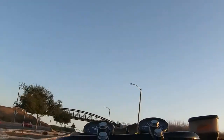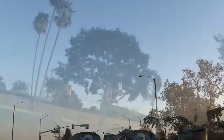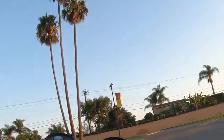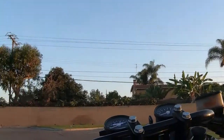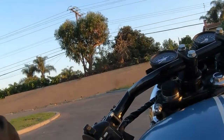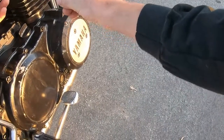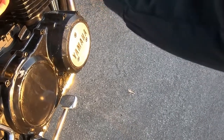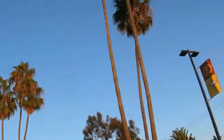I got a lot of popping on my first ride, so my initial adjustment was to turn all three air bleed screws clockwise half a turn and then go for another test ride. I made the clockwise half turn adjustment a few more times before I got to a spot where the popping on low load acceleration stopped. The mid-range felt really good on the bike while riding it, but the top end felt pretty weak, although it wasn't breaking up like it was initially. So my thinking is I'll need to go back in and adjust the needle heights so that they are letting out a little bit more fuel when the throttle is completely open.